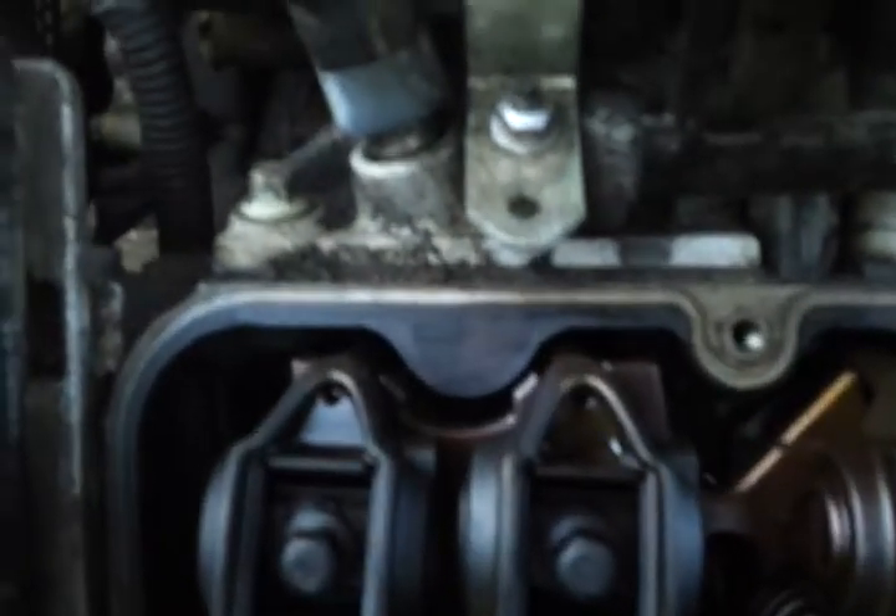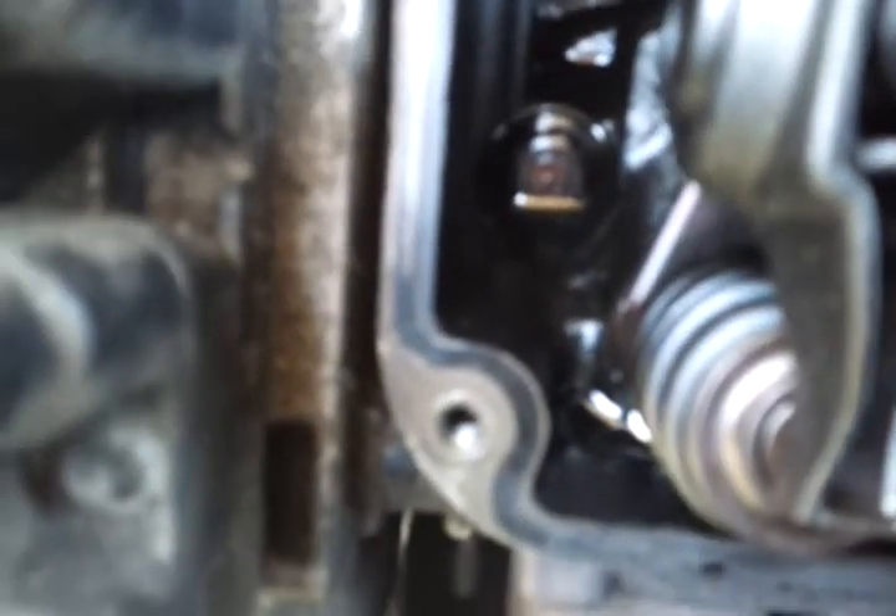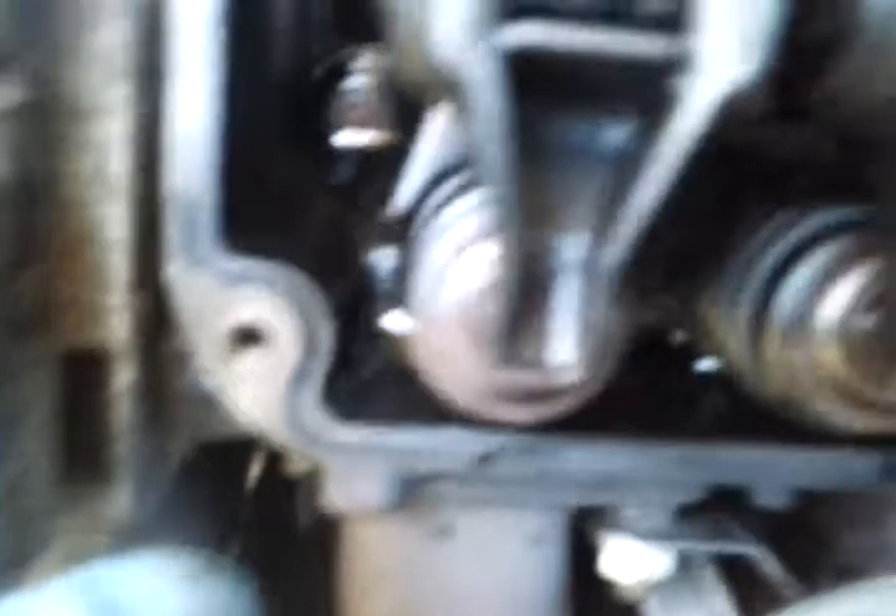I found out the reason why, at least for this front bank. If you look — let me get some light on there — you can see where the old gasket was sitting, that shiny side right there. That's what it should look like when you put the new gasket in. But watch as you come down here — it turns black right there as it comes around the corner, and all the way down along the bottom surface I found a nice thick film of oil, because there's that old gasket still left over right there.